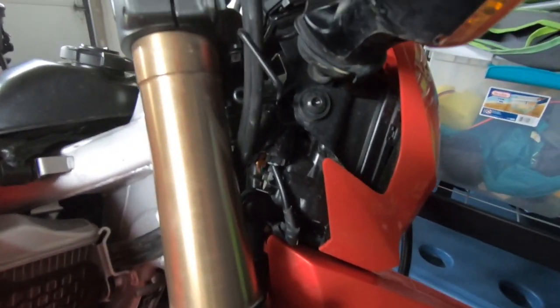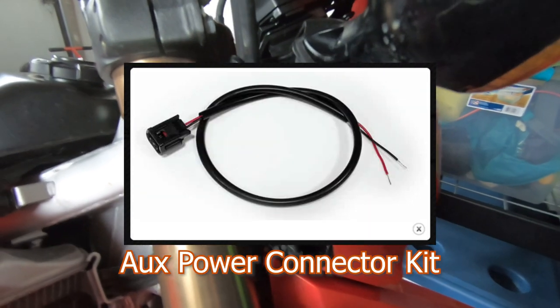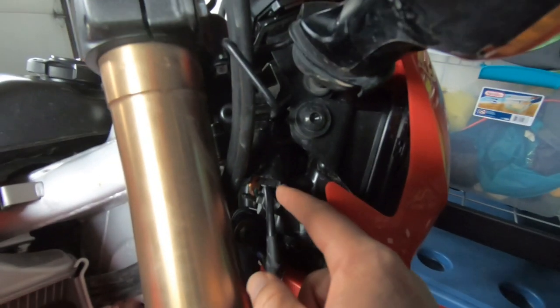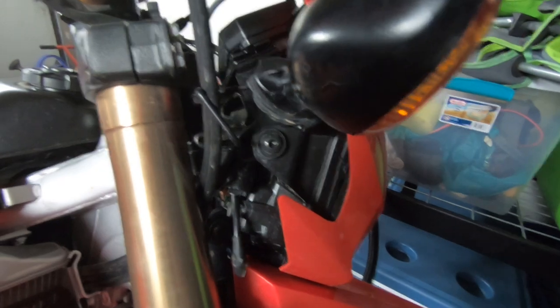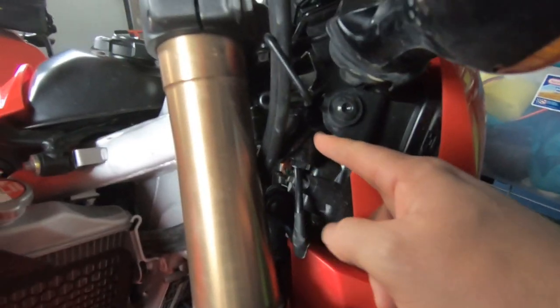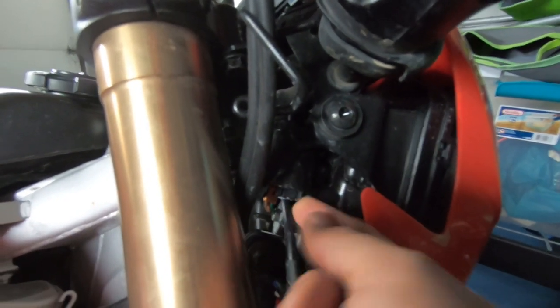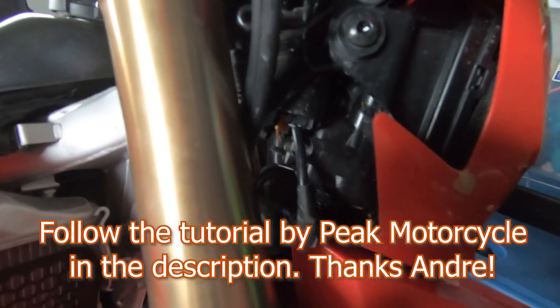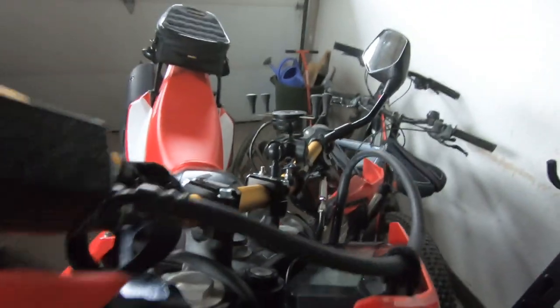To wire the phone charger to the bike you'll need a Honda accessory plug — I'll put it on the screen. I ran the wire under here and connected it. The nice thing is you don't have to dig around or use any screwdrivers to take off the headlight to access this. Honda has conveniently placed the accessory port here — it's just a squeeze and plug, there's a little cap you pull off, and then you crimp or attach that to the line going to the charger. Thanks Honda for putting that in a good place.